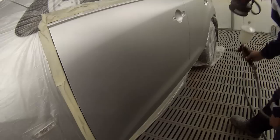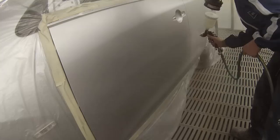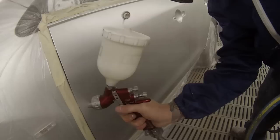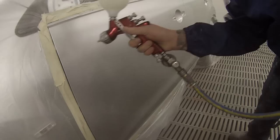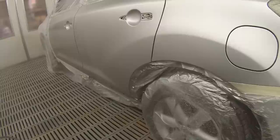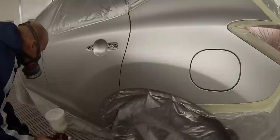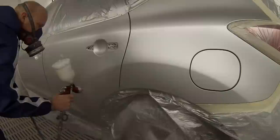Now onto clear. I've just gone out and mixed my clear up and cleaned out the base coat gun, and by the time that's done at this kind of temperature it's pretty much right to go straight on with your clear. With solvent base base coats they'll dull right off and you'll know it's ready to clear — if it's still a little bit shiny then you might have to wait a couple more minutes. I'm using the Devilbiss GTI Pro with the HVLP air cap for this job. The best settings I've found with this air cap is to wind the fluid right out so you're mainly just using gun control rather than the fluid to restrict the flow of paint. Fan setting is open the fan right up, and the air pressure should be set to about 2 bar or 29 psi.